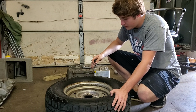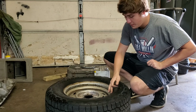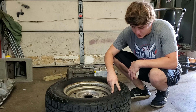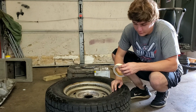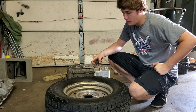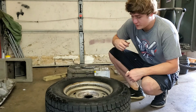After that I'm going to go outside and hose them all off to get them cleaner, then come back in and wipe them down and blow them off with the air compressor. Then I'm going to start taping up around the sidewall so I don't have any overspray. A few days ago when I washed the truck I used some tire shine, and this tape will not adhere to the rubber very well with tire shine on it because it's kind of an oily fluid. So I'm going to go through with some acetone and wipe off the sidewall to get the tire shine off so I can put the tape on properly.